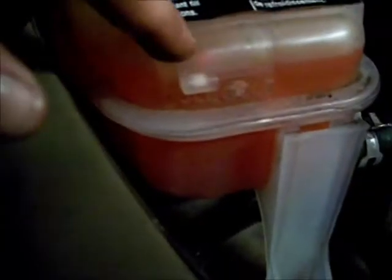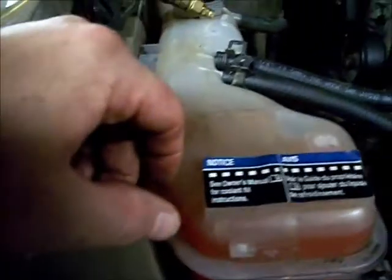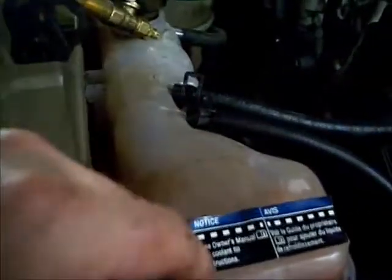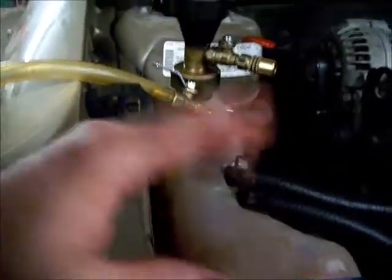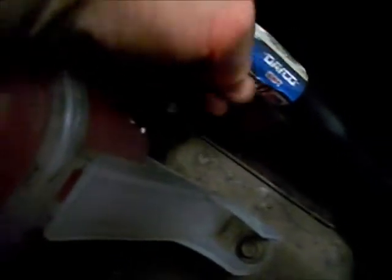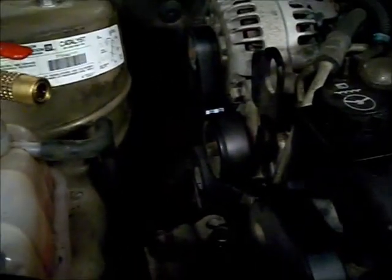Now it's nice and full. Actually, you generally have to stop it for the vacuum the last pound or so, so it'll fill it so full it runs it over once the hoses rebound. Not a drop of antifreeze spilled — no mess. Install these two hoses: this heater bypass hose and this lower heater hose, which is actually a coolant hose to the radiator. Install the new serpentine belt.